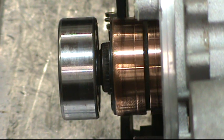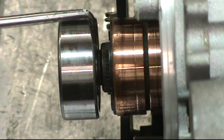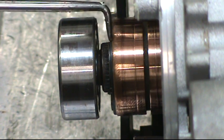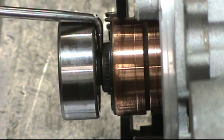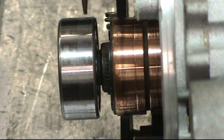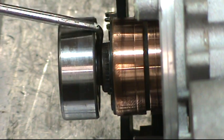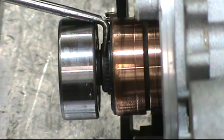What we're inevitably going to be doing is changing and putting a new regulator on there anyway, but during installation, if you have any problems and the regulator has to come back off, the brush tends to get stuck down in this hole. You just have to be careful, get a tool like this, get in behind it, and pry it up because it's spring loaded.